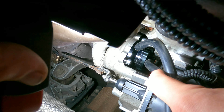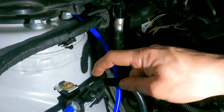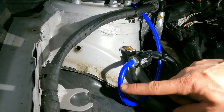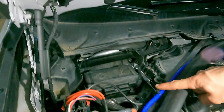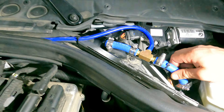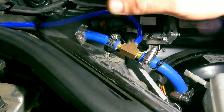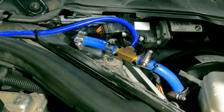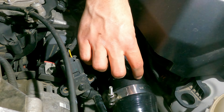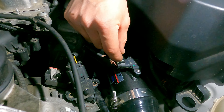For routing: this is the solenoid here, mounted upside down. The top of the solenoid is mounted to the top of the blow-off valve on the barb fitting. The bottom of the blow-off valve — closest to the turbo — runs to the side of the solenoid with the connector. On the opposite side, parallel to the connector, is where we tapped in for our vacuum source, which runs all the way up along the firewall to our T-fitting. This will all get covered up so you won't see it.